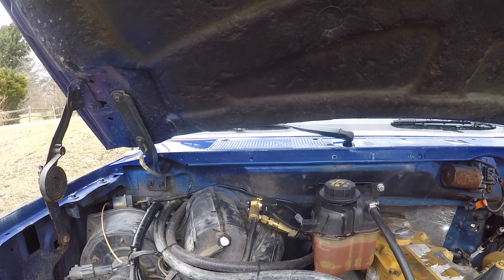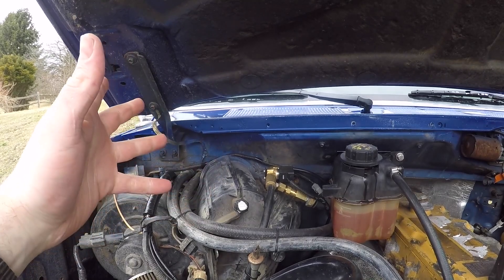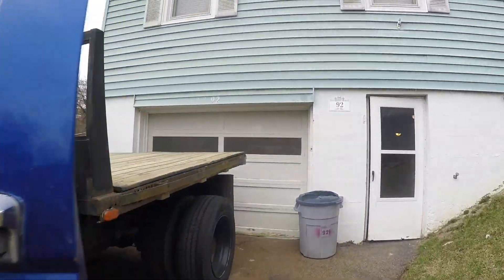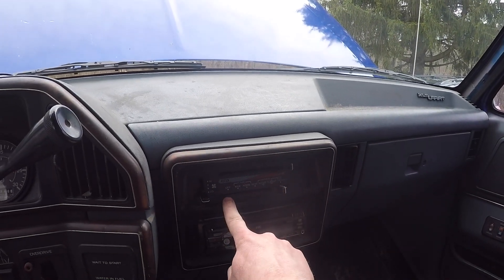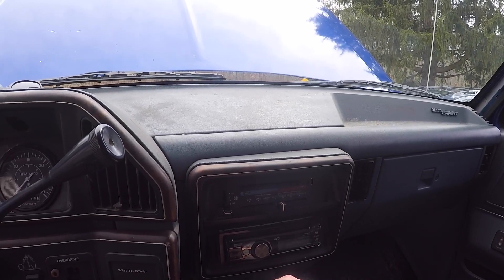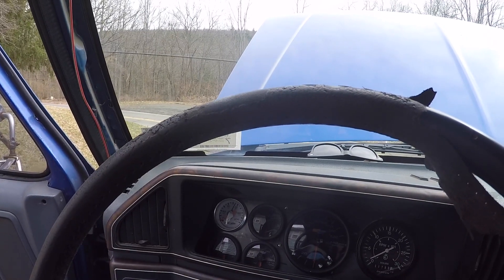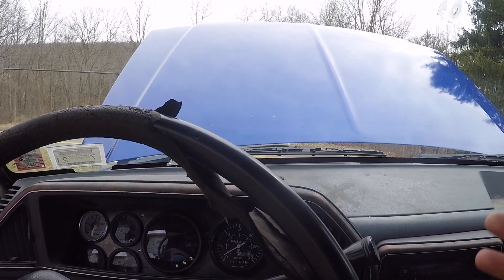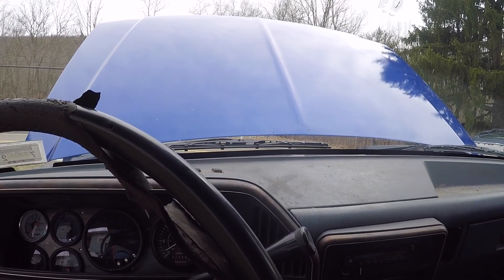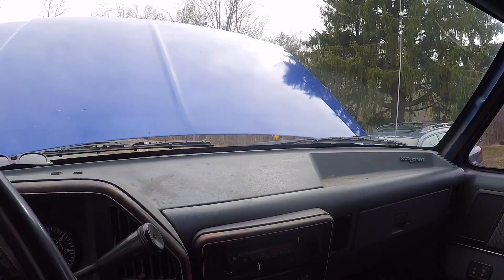The Venturi system is in, all wired up and plumbed in. The exhaust air I looped around and put a muffler on it to keep down some noise. The key has to be on and the heat has to be on — if it's in off, it won't run at all. That's basically pressurized air from our air system blowing through a Venturi and sucking it out, so the vacuum diaphragms can open and close. It does pulsate, and I think that's due to where I put the sensor — moving it elsewhere would probably smooth it out. For now it's better than what we had.